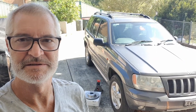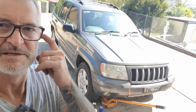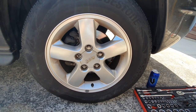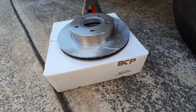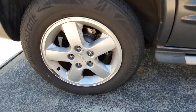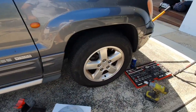Hello everyone, welcome back to Sully's Rosin Customs. Today we're going to change the brake rotors — or discs, whatever you want to call them — on this WJ 2004 Jeep Grand Cherokee. The issue I've got is I've had these discs machined twice, and every time I machine them I get a real shudder in them after a couple of months. I get them re-machined, shudder goes away. I think they're just some cheap stuff, so I bought these drilled and dimpled rotors, BCP brand — Brake and Clutch Pro. I've done the back ones prior and they've lasted really well, no issues. So I thought I'd put the front ones on the same and see if I can get rid of that issue.